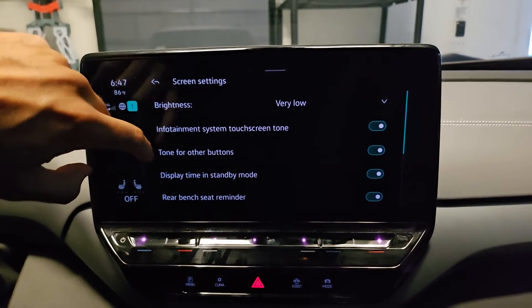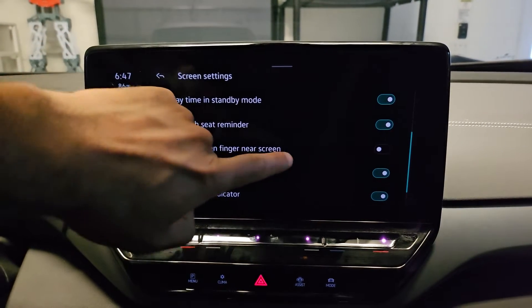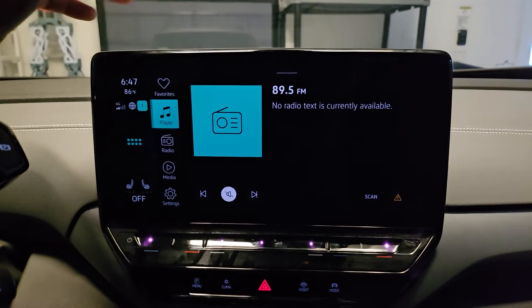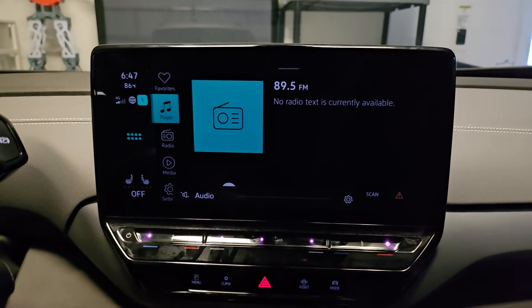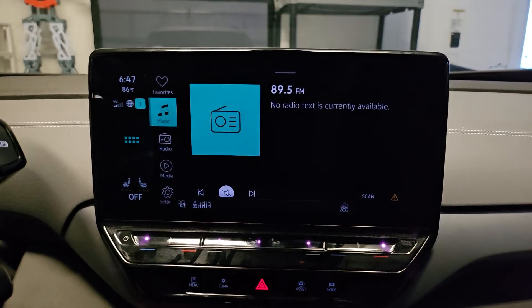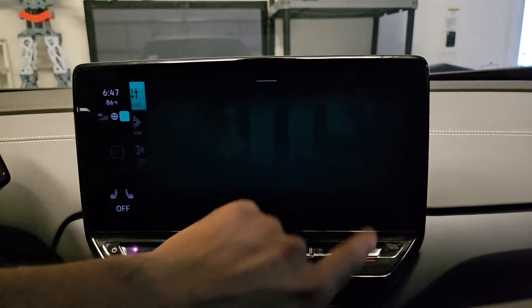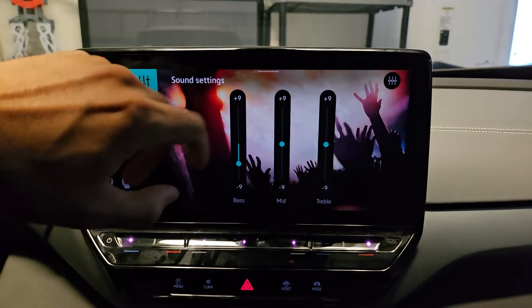Screen animation when finger near screen — get that off. And of course with the radio, make sure you've turned down the volume. Don't have it that loud. The louder you go, the more energy you're going to be using. And with that, go to sound and turn down the bass. Bass uses more energy than treble.